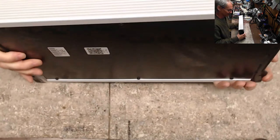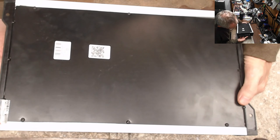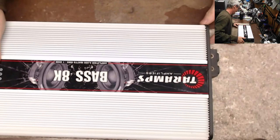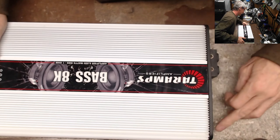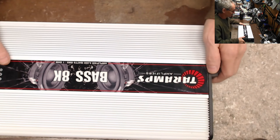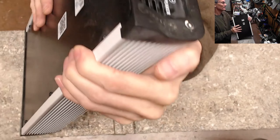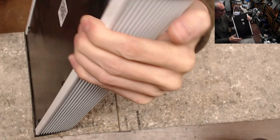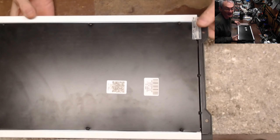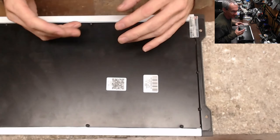One thing I look for is: was the amplifier secured down? I really can't tell. The paint on the mounting holes doesn't even have a scratch on it. Let me check the speaker terminals, make sure there's no external visible shorts — and there isn't. So far I'm not seeing an issue when it comes to installation, like a cable moving around in a trunk and shorting out to the case, which would be an end-user obvious failure.